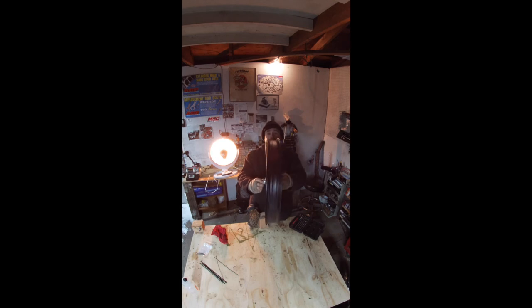You can see it has seen better days — basically hit some unexpected stick action in the woods. The stick got up in the mix and managed to karate-chop quite a few of these spokes out and mangle quite a few others. So we've got to knock this rotor off, do some forensics, do some re-lacing, and hopefully get this thing tensioned up to close enough. Let's go.